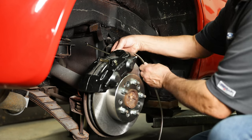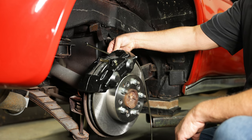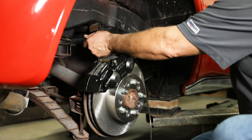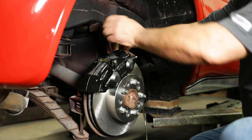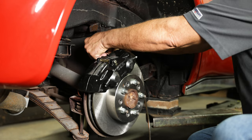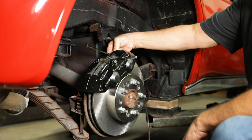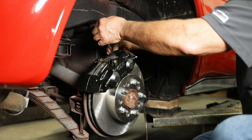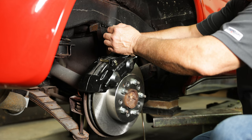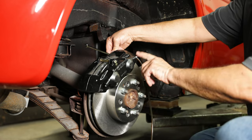Until I see no air in the line. Go ahead and pump it three times and then hold it. Crack it open — some air bubbles, you can't hardly see it but I can. Let it up. Three times again and hold. Okay, let it up — we'll do that one more time on the inside, then I'm going to switch to the outer.